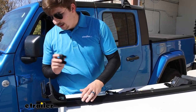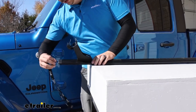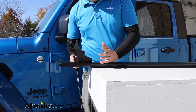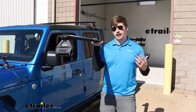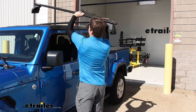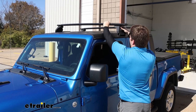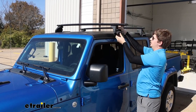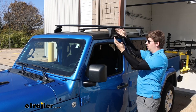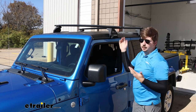Take your end cap and install it on the ends of the crossbar, then use your tool to lock it in place so nothing slides out accidentally. Repeat that on the other side, and then we can get this on the roof. It can come in handy to have an extra set of hands on the other side to help guide this into the gutter over there, but you don't have to. Just loosely set it in place, get this side started, then go over to the other side. Set that in the gutter, wrap the clamp around, and get it set roughly where you want it. We'll measure it out in a moment.